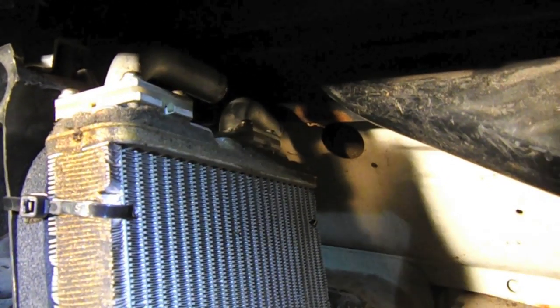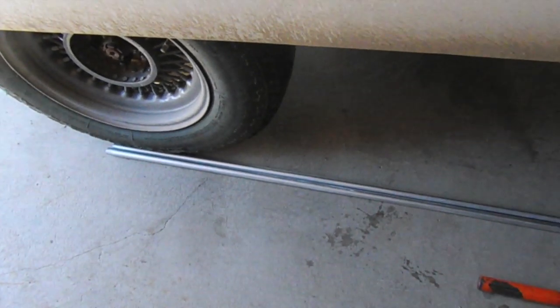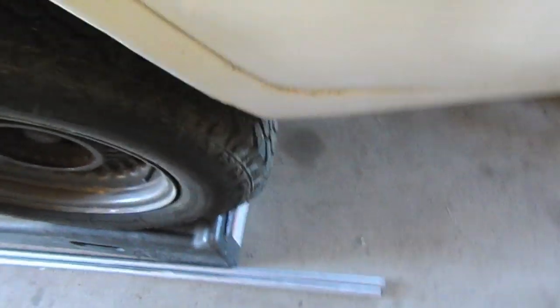To get the coolant to the heater core, I decided that I'm gonna go with EMT conduit. This is just half inch galvanized conduit, essentially. So the reactivity between this and aluminum is pretty low, lower than stainless steel apparently. So you also notice that it's the perfect length for the bus.